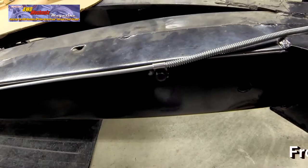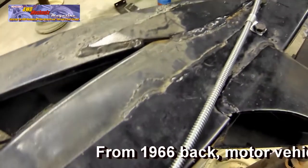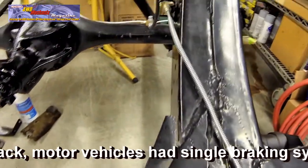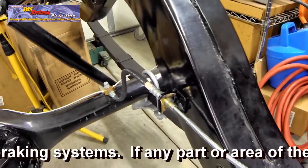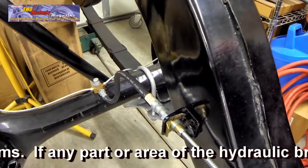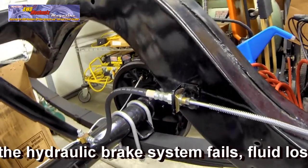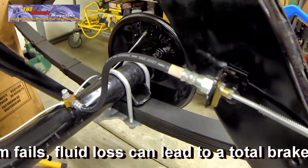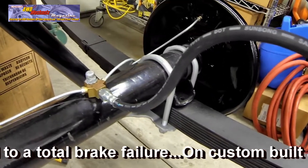This armor guard is shown in the factory parts illustrations. If careful attention is paid to the assembly of the car and the design of the frame and body, it's obvious that the body could chafe on the brake tube. Being a single braking system, that could be catastrophic. The body rubbing on the tube could wear a hole in the tube, and if that were to happen, there is no backup to the braking system. This is a single braking system.